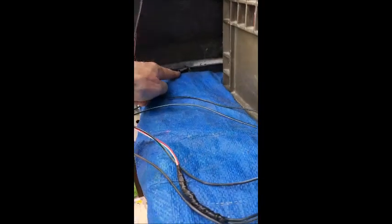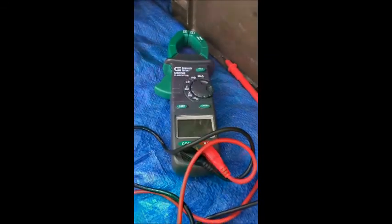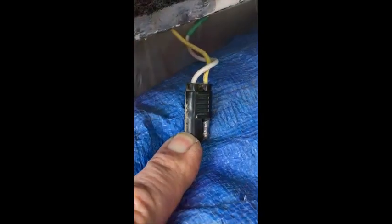I need to figure out which wire is positive 12 volts so I can clip off the connector and solder it onto the new red and white wires. I used my volt meter to check these, and found the female connector is positive when you hold down the brake. I put a little plus mark on that side to remind me, and I verified that when I put the red wire to positive and the white wire to negative, it does light up the light bar — so everything checks out.